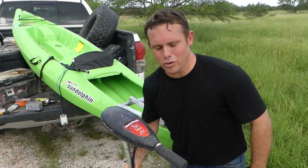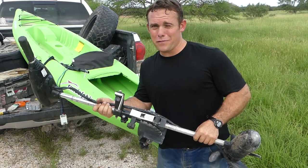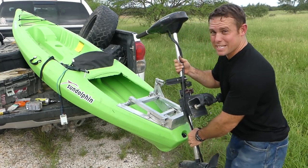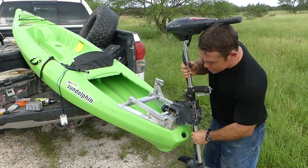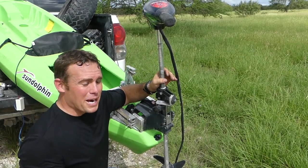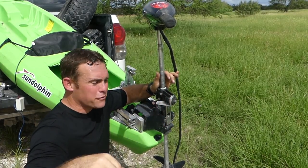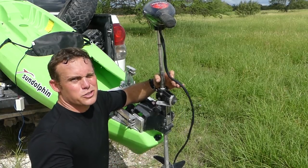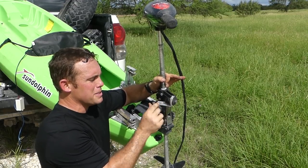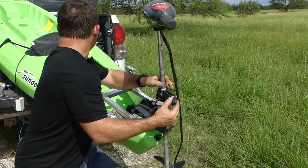Here's my old 54-thrust Motor Guide — I'm going to use this. It's just a 54-thrust, works just fine, and I haven't used it in a really long time. Here's the first bracket I made for this trolling motor. This extension actually came from a steering mount for a non-foot-controlled trolling motor, just like a transom mount — basically a long pole that steers. I just took some aluminum and built a little angle off of it so it can be an arm to steer this thing.